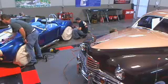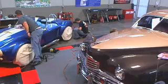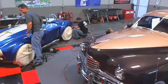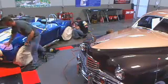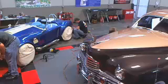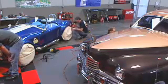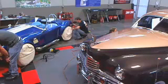Yeah. Then switch it, go up and down. Yep. There's a couple reasons for that. One is it ensures uniform material removal because you buff all the paint about the same amount. And so that means if you're removing all the swirls here, they should be gone everywhere.